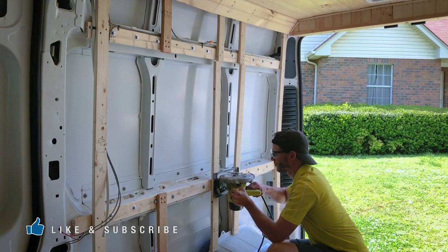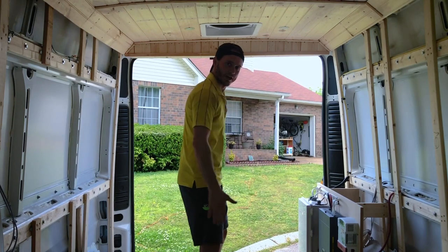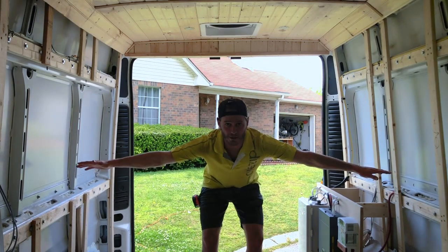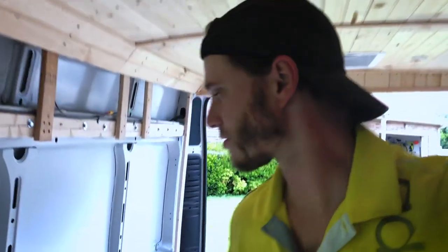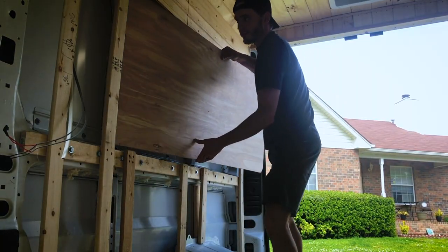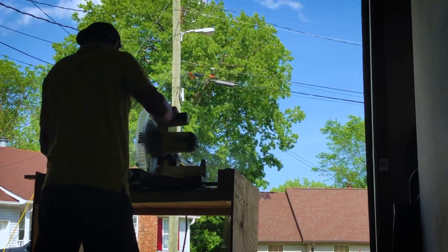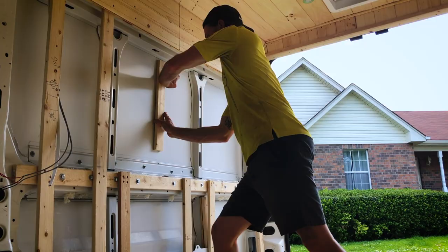Well, that looks like shit. So I cut into my framing — why did I do that? This right here is our bed, head to toe. Before I cut those pieces of wood I can expand my arms and touch both sides. That's not much sleeping room. The plan is to frame this out a little bit further inward, giving us an extra two to three inches of sleeping room — an extra two to three inches can really make a big difference. So I'm using one quarter inch Luan in the cutout area for more leg space. The problem? This stuff is brittle and weak, so I wanted to use some extra framework glued to the van walls as an extra brace. But no matter what I tried or how long I held, the adhesive wouldn't stick. That shit didn't work at all.